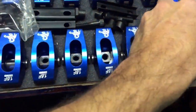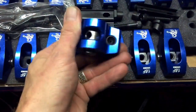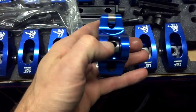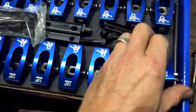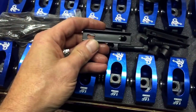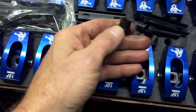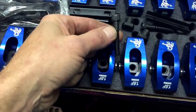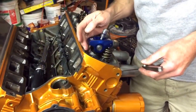It's a shame to put a valve cover over them, but that's what you've got to do. The package includes individual roller rockers, the push rod cup end, the roller tip, and the saddle where it rides. You also get rocker guides — one per cylinder — along with the rocker saddle and rocker bolts.